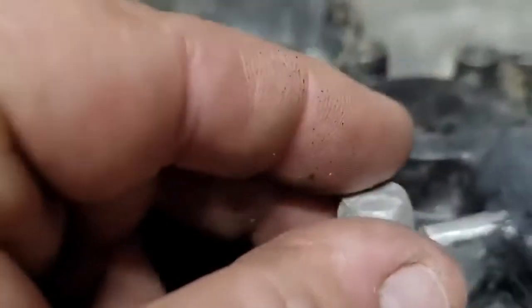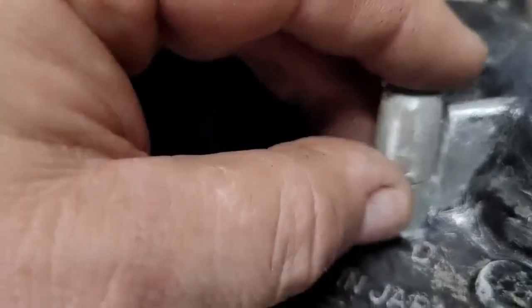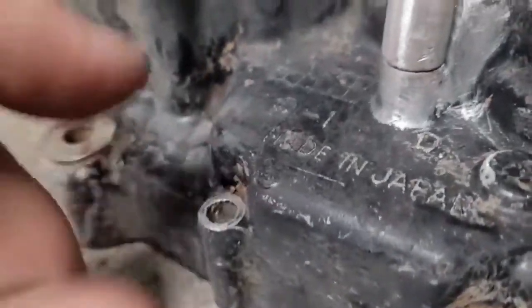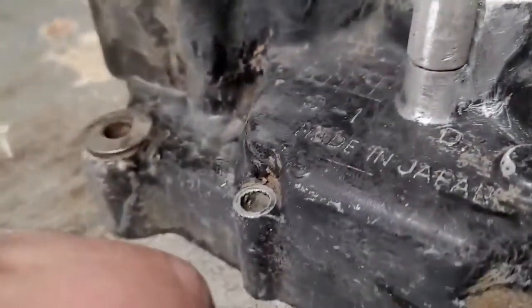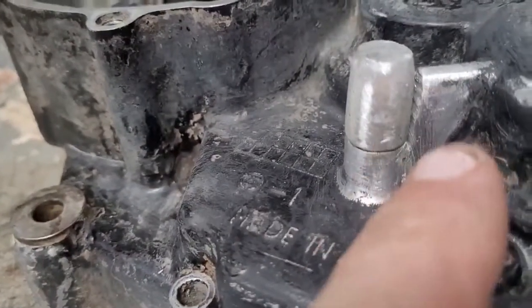And when I put this on here, I'm going to set some epoxy on here, and I'm going to set this guy down. What I'm not going to do, when I put the epoxy on, is squish that all the way down super tight, because you're going to squeeze out most of the epoxy, and you're not really going to have much that's really grabbing onto it. We're also going to have some back here, of course.